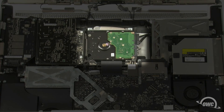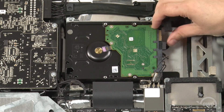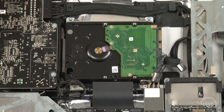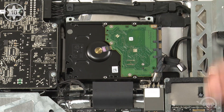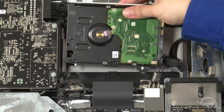The hard drive is located here. The first thing to do is disconnect the SATA cables on the hard drive. Next, remove the two Torx T10 screws holding the drive in place. Finally, lean the drive forward slightly and lift it up and out of the iMac.